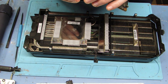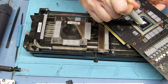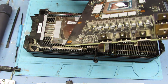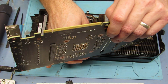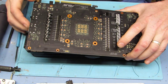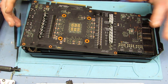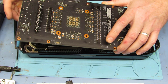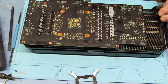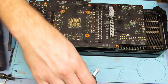Being picky getting most of the old thermal paste off. Make sure you don't get that thermal paste or remnants of the old stuff anywhere on the card's electronics — it is very conductive and can short things out real quick. The best way to do this is to plug in the LED connectors first, then sandwich the PCB back in. You've got standoffs you have to line the card up with, and we've still got the X bracket to install. Make sure the thermal paste is placed correctly — otherwise you're going to short stuff out.